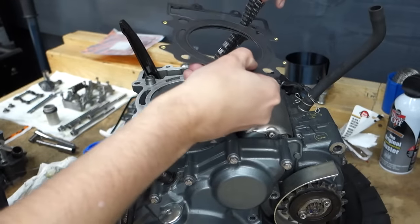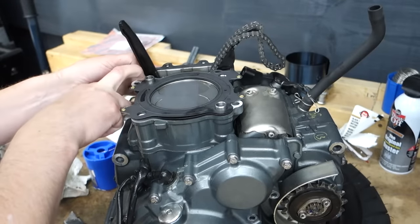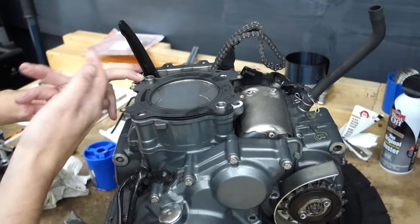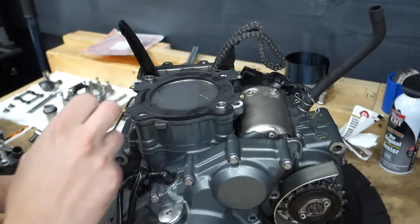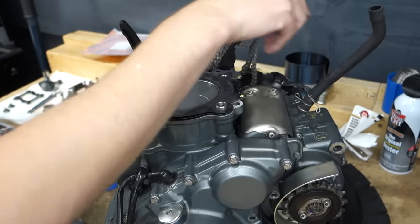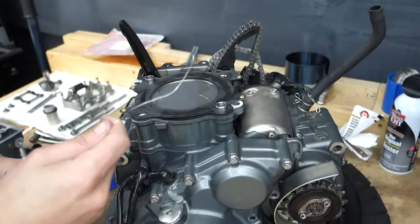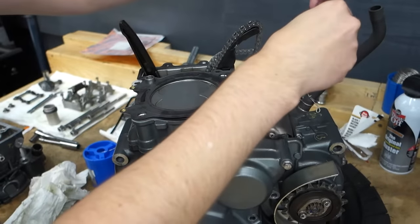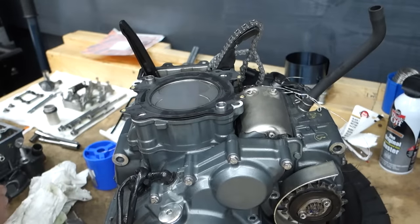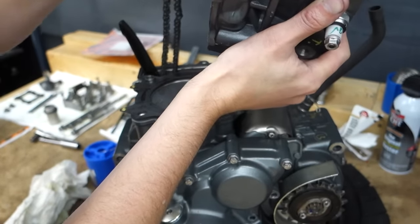Let's slap this on here. That actually goes under the gasket. This gasket serves a lot of purposes - it's blocking out water passages and retaining things. KTM is asking a lot of this little gasket. So we got the gasket on. This is the arm that needs to move for the head to go on - if we move this one we're going to upset the gasket and everything, which just really wants to walk away. We're going to thread some safety wire through here; this will let us easily retrieve it later. We take our head that weighs like 15 pounds.